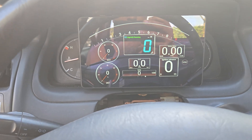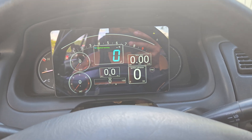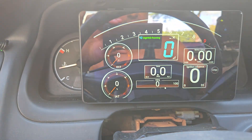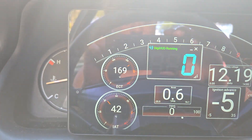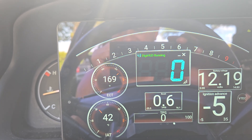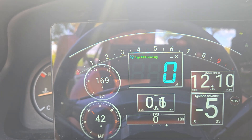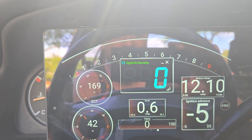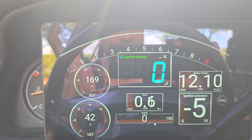Now I kind of want to talk about coolant temperature, and this is one of the things I love about cars — thermal efficiency. Just remember that if your car is, let's say, 165 degrees or something, driving at 169 right now — just because your gauge says you're at 169 doesn't mean your motor is at 169. Remember, coolant pulls heat from the motor, so your coolant is never the same temperature as the engine. The engine is actually hotter — could be 10 to 15 degrees hotter. So keep note of that on the dyno: if your operating temperature is 185 on your gauge, your engine is probably more like almost 200, maybe 190-something. Typically I do pulls at 175 or 170 on the dyno because I know the engine is probably around 180-something.